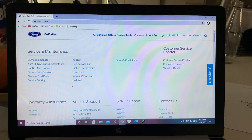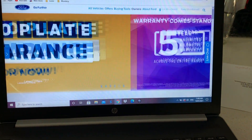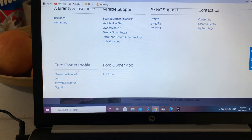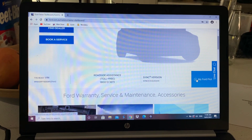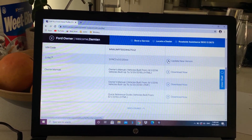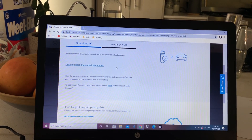If you don't know what you need to do — especially in Australia, which is where I am — just go onto ford.com.au, log in, and you need to register your vehicle by putting in your VIN, create an account, and then it'll tell you what version your radio is on. Go down to your profile and it'll show SYNC 3 and the version. Mine was 2.0. Just next to that it says 'update.' Go into that, request the download file, Ford sends it to you, then you download it onto your computer and transfer it over to your USB stick.